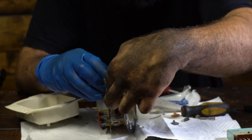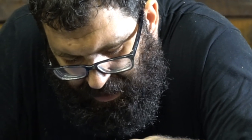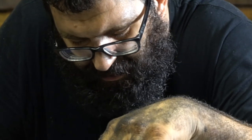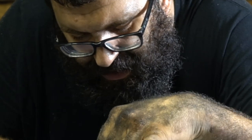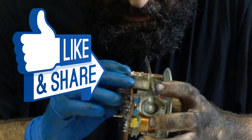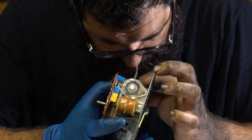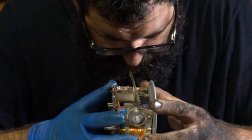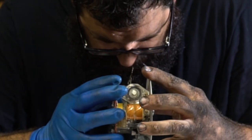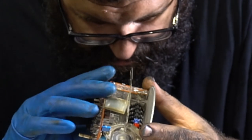Mercedes and VDO, I think, were kind of evil about the way that they built these odometers — they really built them to fail. The good news is that most of the replacement gears on the market are actually pretty good. By the way, there's a little resistor in here that lives in a teeny tiny little housing. These have been severed all the way, so I'm going to have to solder these back together.